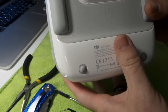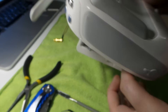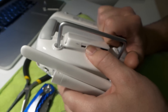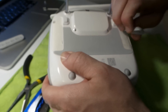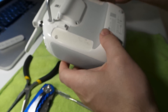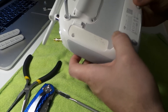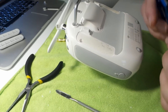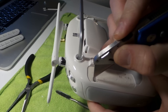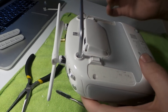On the back of the transmitter you've got these rubber dampers here — one there, there, and these two large ones right here. These just peel off. Stick your fingernails basically underneath the big one and kind of pry up on them. You've got this basically double-sided tape which is almost like a glue. It either comes off with these dampers or it stays on there. Then cut across in these holes so you can easily get a screwdriver in there.